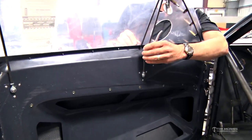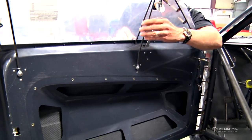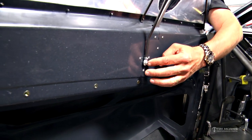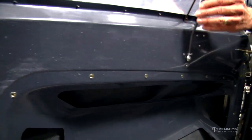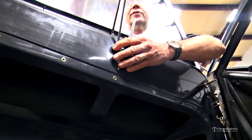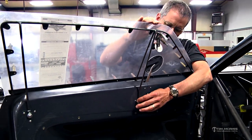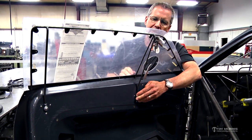This all comes with the kit and this tube has got a little rod end in it both front and back. There's a plate - you can see these three 6-32 screws here - there's a plate behind on the inside of the door that's got a threaded insert in it that this fastens to. What that gives us the option to do is adjust this rod end to get the window in and out to set the tension on the body when we're done. So we can adjust this - if we want to pull the window in at the top we can shorten this rod end up and pull that in and tighten it so it lays against the body nice and tight.